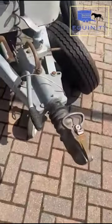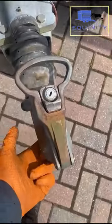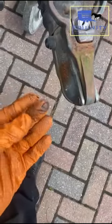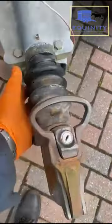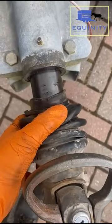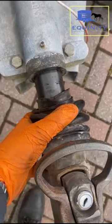I'm going to start at the front of the trailer. The damper and the coupling at the front end is quite important. This bit underneath here needs to be greased — I'm just sticking my finger in there and there's very little grease in there, just a little bit of blackness. That should be nicely greased up. The bellows here are actually upside down; these holes should be at the bottom, and it's come away from the coupling itself, which means all the grit and dirt can get into your drawbar and affect how it operates.